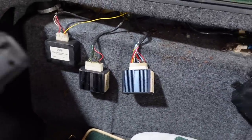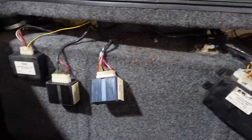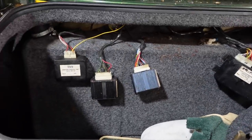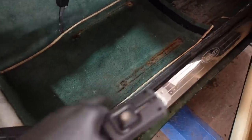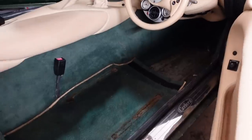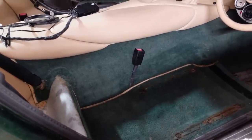Moving to the rear of the vehicle - I need to remove the fuel tank, so I'll have to remove all the control modules, get the wiring out of the way, rip the carpet up, and then hopefully just lift the tank out. I've already removed the passenger seat and started undoing the body bolts underneath, and I've also removed the rear benches to get to the seatbelt anchors. The annoying thing is everything is a nut and bolt, so I'll need help - probably from my dad - to undo them simultaneously. I'm quietly optimistic, but I guarantee I'm missing something.